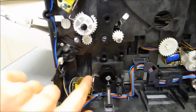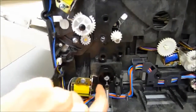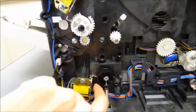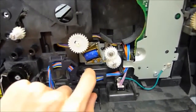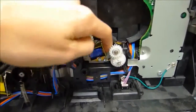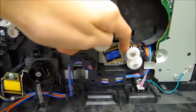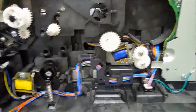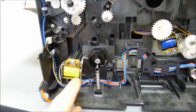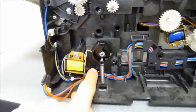Originally when HP sells these, there's a little tiny bumper that basically prevents noise. But over the years, that bumper gets worn down and all that's left stuck on the metal is just the adhesive that originally held the bumper in place. What happens is that the adhesive causes this little metal armature to stick in place, and because printers depend on millisecond or less time differences, obviously everything goes downhill from there.